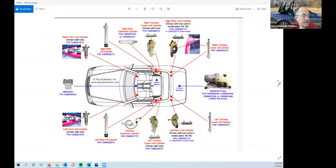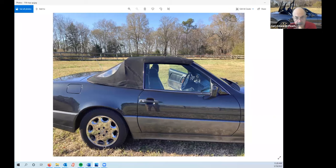The other piece of diagnosis is: where does the top stop? If the cylinder is really leaking badly, the top will stop operating when it gets to that cylinder. It's important to understand the operational sequence of the top to help you diagnose. Not all cylinders will fail with an external leak — it is physically possible to have an internal leak so that oil bypasses the piston and you won't get an external leak. So you need to know the top sequence to diagnose that.